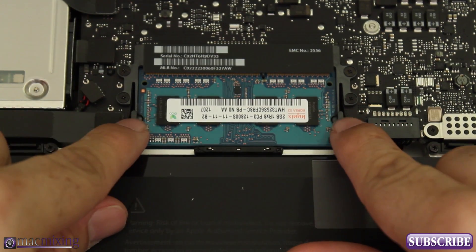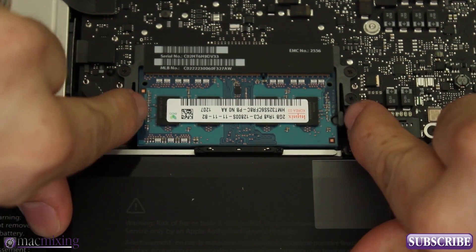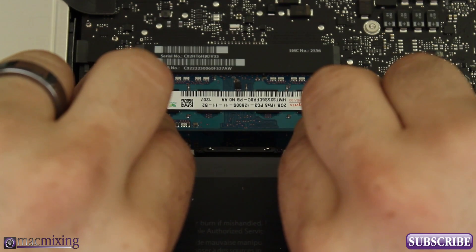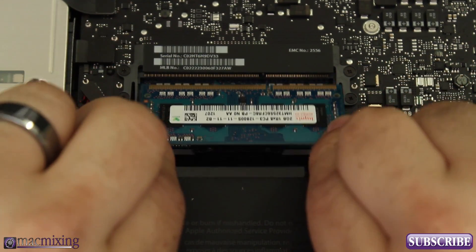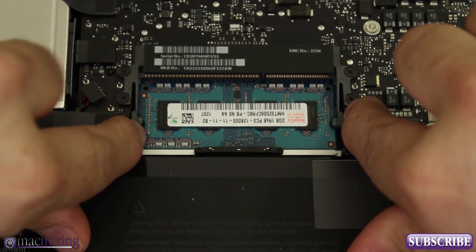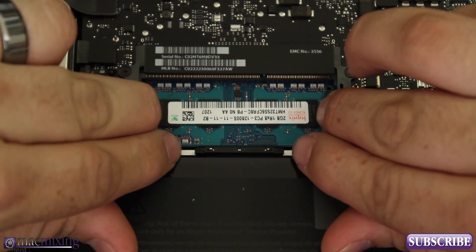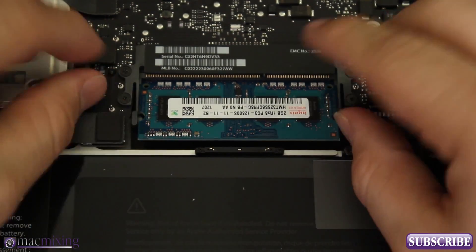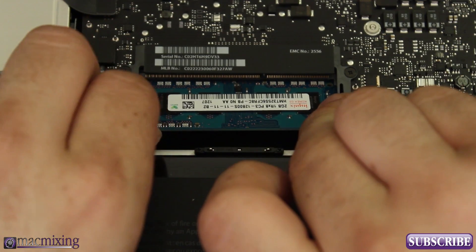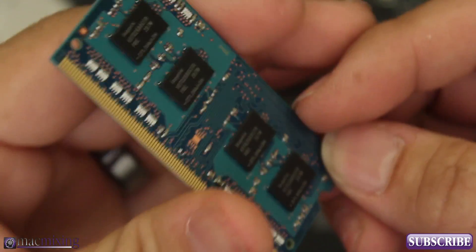What we want to do now is remove the RAM modules. The easiest way to do this is to take these little side levers right here and, with your nail or whatnot, pull them outward like that. You'll see the RAM module pop up, and then from there we can pull it out towards us — just like that, nice and easy. Set that aside. The bottom one's a little bit trickier — you have to make sure your fingers are out of the way so it can pop up. Do the same thing, and you may have to do it again once it's pulled up a little bit, then pull it right out towards us.